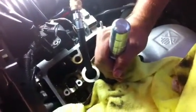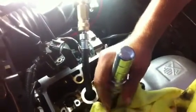We're going to take the valve master — using the full tool because we're on the exhaust side — and put it over the top. Make sure it goes over the top of the valve; you don't want to bump that valve. Just tap it until you hear it start to sound solid. Hear that sound? That means it's done — it's seated. Look inside, verify it's seated properly. Good. Wipe off any gunk that got in there.